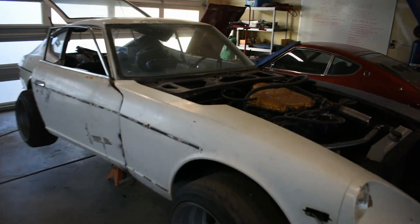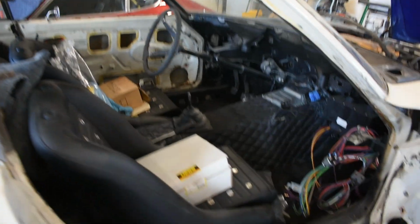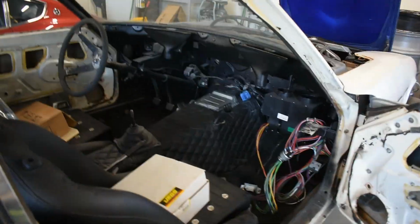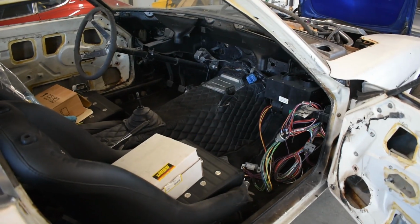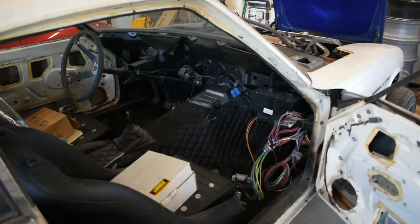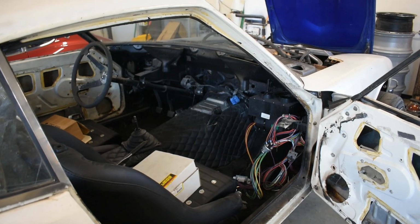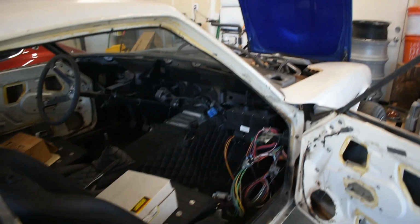Alright, so my camera overheated there a little bit. What I was talking about with the gauges, so you have a couple options. One of the easiest options is actually this OBD2 port, okay? If you make sure to rewire your OBD2 port back in, because some companies like RacePack or some eBay, AliExpress companies sell RacePack style gauge clusters that plug in directly to OBD2 and will read OEM values off of your ECU. So you can get things like RPM, oil pressure, oil temperature if your ECU reads it, coolant temperature, just, you know, the important stuff you want to know.